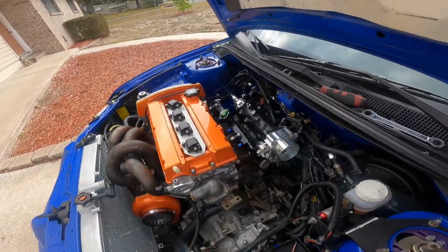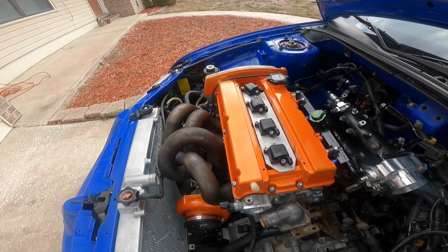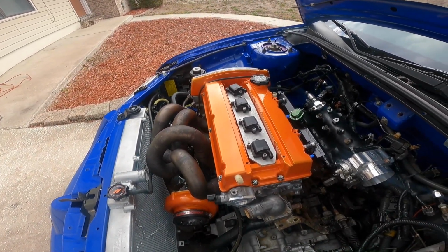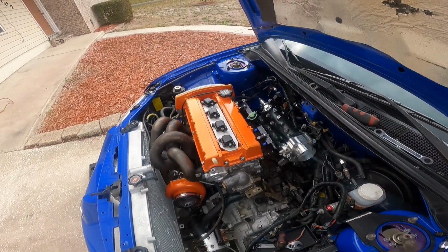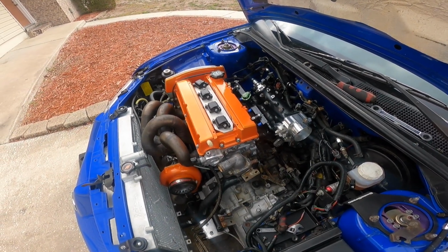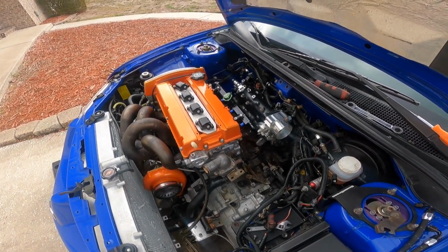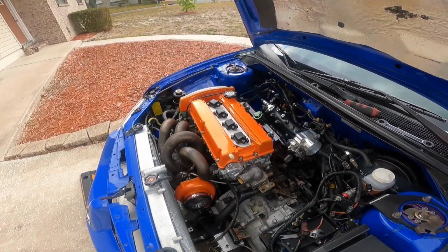So today, I gotta take off the injectors, get those cleaned out. We're gonna take off the valve cover because we wanna make sure there's no sand from the blasting or the powder coating behind the baffle area. So we're gonna drill out those rivets, replace them with screws and Loctite them. You know, just to be safe. Can't afford no jokes, you know.